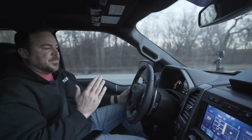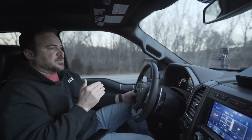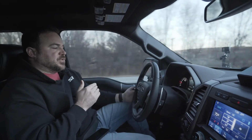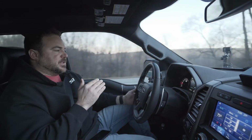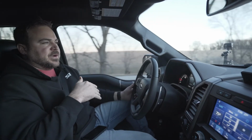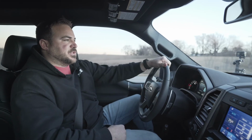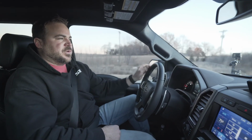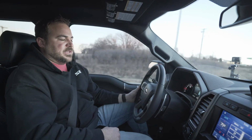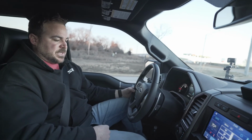So it's important for low speed pre-ignition, LSPI, on these motors to shift the torque to keep the motor centered around peak torque, or very close to peak torque, versus lugging it like we would, or allow some of our diesel calibrations to do. We don't want all the cylinder pressure to just kind of beat this motor to death. So that's kind of why we shift those calibrations around.